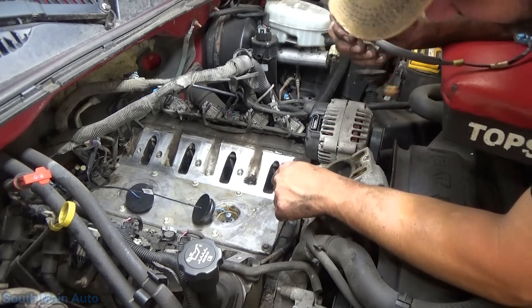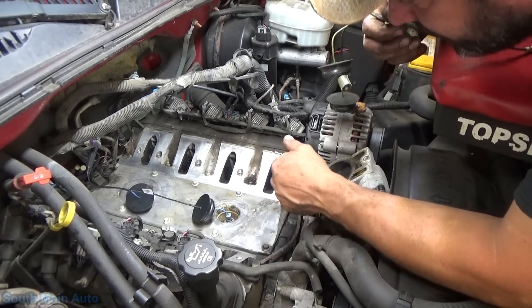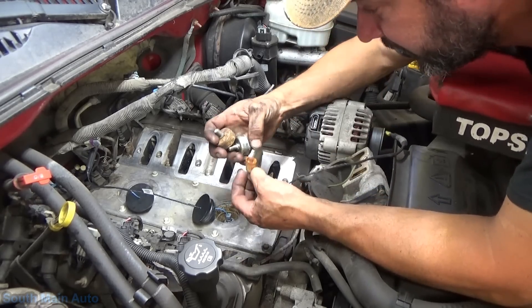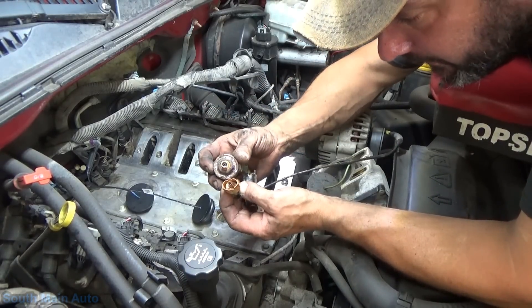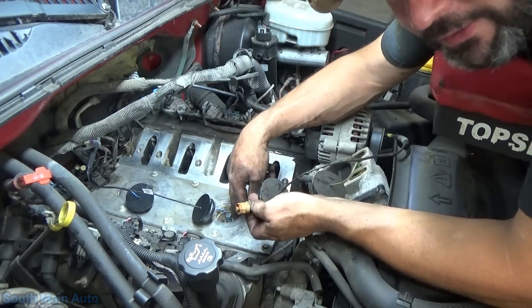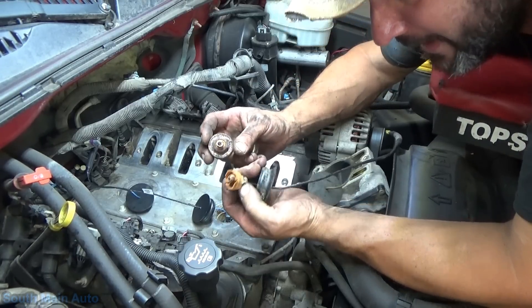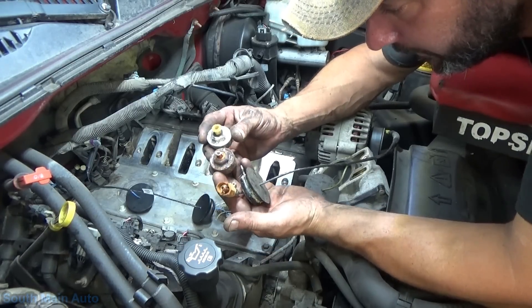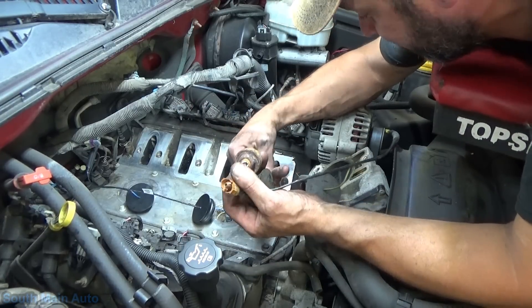The intake is off — there was a sludge pit, so I cleaned it up with the vacuum cleaner and my super scraper. The front hole, sensor number one, was a rusty turd. You can see that it was drowned in water at some point — there's about a half inch of rust sitting on the bottom of the hole. That's the knock sensor connector, and this is why you typically have to replace them. New ones are installed, torqued to factory spec.